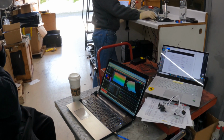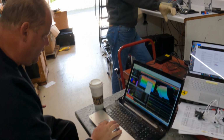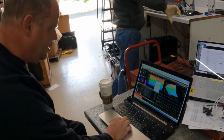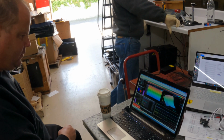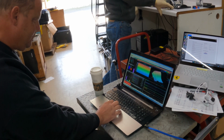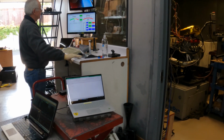So I think turn on the fuel pump and let's see what happens. So do we have, hold on a second before we go any further. 425 divided by 6.89. So yeah, 61 pounds of fuel pressure, right? So that's probably legit. Okay. All right. And he's showing 60 up there. He's tracking too. It's close enough. Okay, I think crank it and let's see what it does. Okay. Oh, you know what?